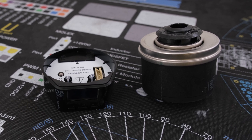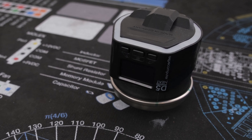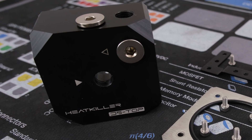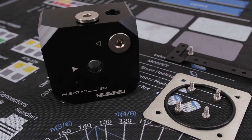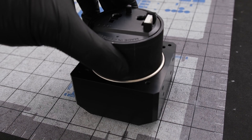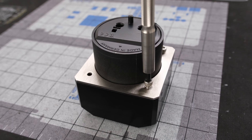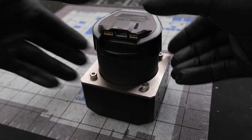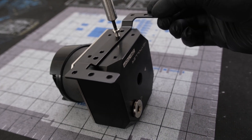For the pump, we're using the Aqua Computer D5 Next. Building upon the standard D5 pump, this one has an OLED display and a fan output to directly connect and control fans. To house the pump, we have the WaterCool Heat Killer D5 top and the Flex 120mm bracket to mount the pump to the radiator. We'll drop a black rubber O-ring into the pump top, followed by the D5 pump and the pump top bracket, secured with four hex socket screws.